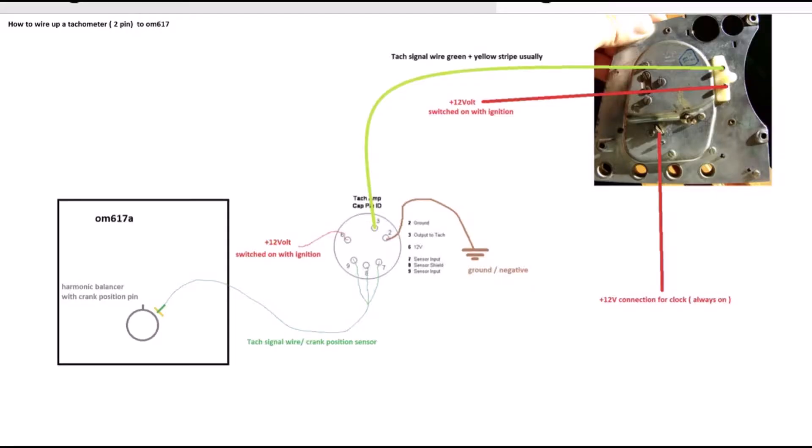Your system is made up of three different parts. A crank sensor that picks up a magnetic pulse every time your crank rotates one time around. An electronic amplifier — a tachometer amplifier in the middle — which basically amplifies the pulse and makes it into a digital signal that is read out by a third piece: your gauge and your dashboard, which gives you a needle position.